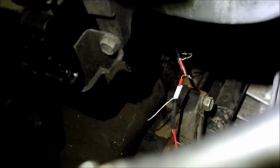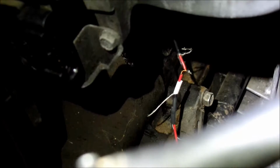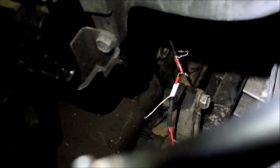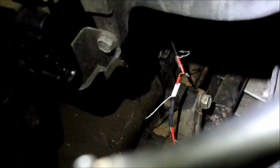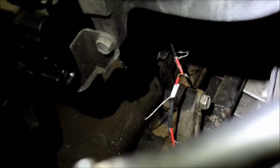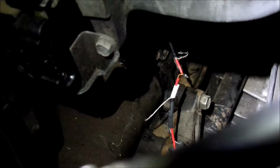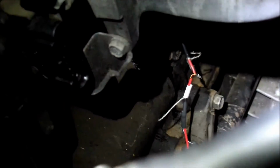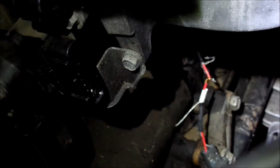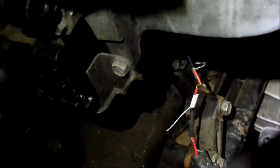What I might wind up doing is put that heat shrink tubing on, and then paint it. I don't know if it's going to cover all of it, so I'm going to start painting it with that electrical tape paint. Maybe I'll twist the ground wires around the wire, like how it was before, then braid them together at one point and solder them so they get a good connection. I can't put any heat shrink on it now. There was no heat shrink over it anyway, so maybe I can just put one really big one, or I'll just paint it with the electrical paint. That should work.